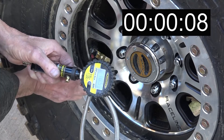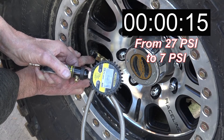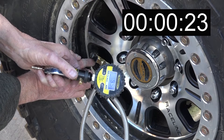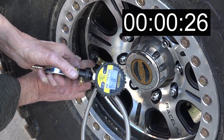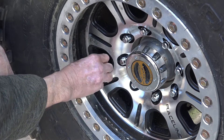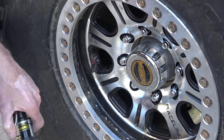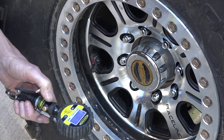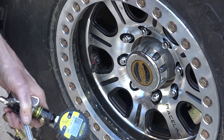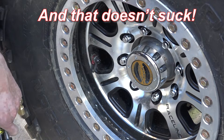We're watching the gauge to make sure we get down to the right threshold. And there we are at 7. When we're done, just disconnect, put the valve cap back on, and we're good to go for one tire. At 30 seconds to air down these big 40 inch tires, that means we can air down all four in about two minutes, plus time to move around the vehicle, hook up the tire gauge, and unscrew and replace the valve cap. We're looking at maybe three to three and a half minutes total to air down from 27 down to 7 psi. Pretty fast.